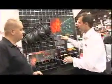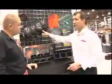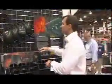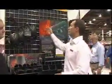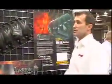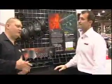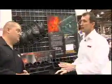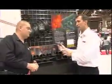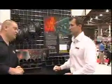So you've got the OEM fitment for all the vacuum points, everything like that. It fits the LS1 fuel rail without modification, the LS2 fuel rail without modification, the L92 fuel rail without modification. We run the map sensor at the back for LS1, the map sensor at the front for LS2. So all the way along the design, you know? So you're able to keep basically one part number for the whole family. Exactly. We have 2 part numbers. The only reason for that is simply because of the arch port for the LS1, LS2 versus a square port for the L92. Okay. Wow, fantastic.